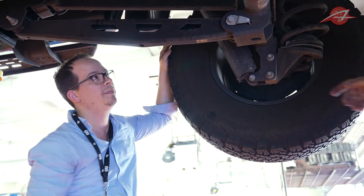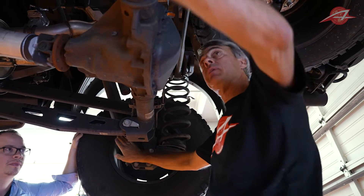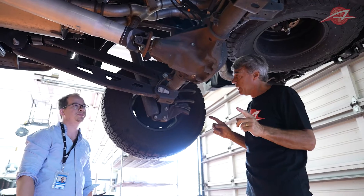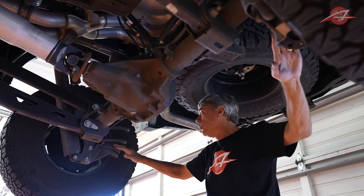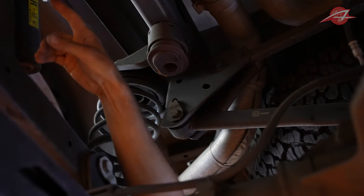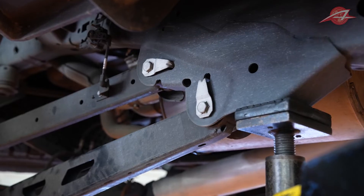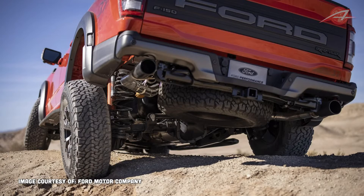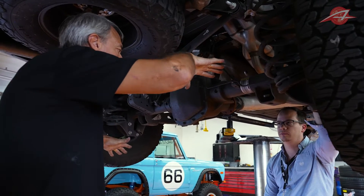Because the four-link controls axle wrap, you don't need to stagger the shocks, so both dampers are on the same side — the front side of the axle. And since you no longer have a leaf spring acting as a spring, you need separate springs. These designs use coil springs, one on each side, mounted behind the axle going from a perch welded to the axle tube up to a bracket on the body. Those spring brackets and the damper brackets are unique to the Raptor. The key advantage is far more articulation than a leaf spring design, because leaf springs bind as you try to twist the axle, while multi-link suspensions don't bind.